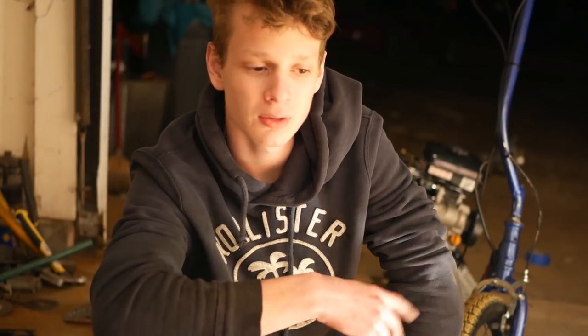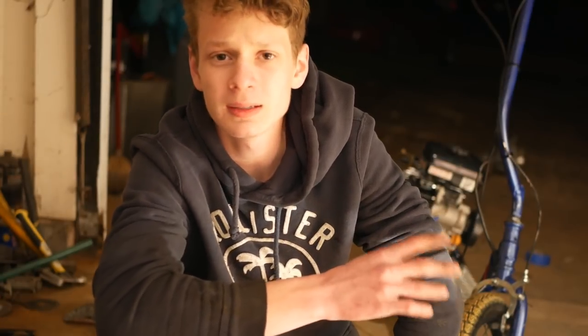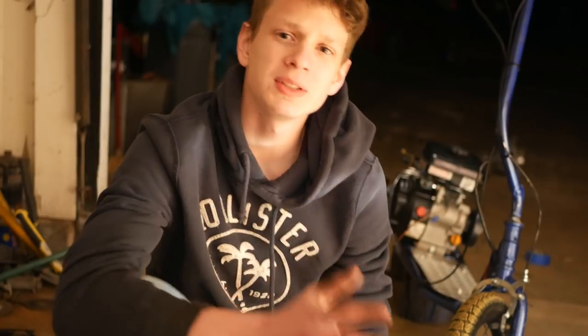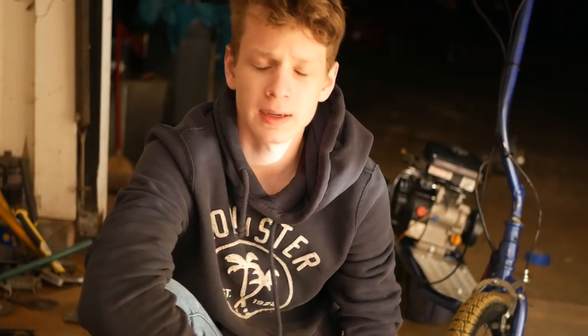Now in the other video, I was running a 49.2 sprocket, but now I'm running a 66.2 sprocket. So definitely not as fast, but it has that torque. So I'd say right now it tops about 22 miles per hour. We could probably get it to 25-30 with some mods, and possibly a sprocket change could do a lot for us. But I'm satisfied with this thing.